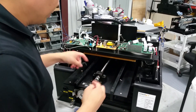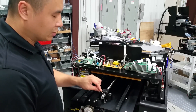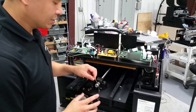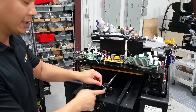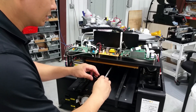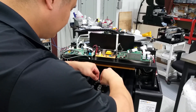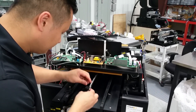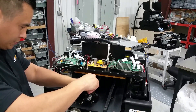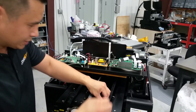So what we're going to do is test to see if the DC clutch is the faulty component or not. You don't have to reroute the cables just yet — we're just going to replace it. Let's go ahead and loosen up the two set screws. Be careful not to lose these screws because they are extremely small.